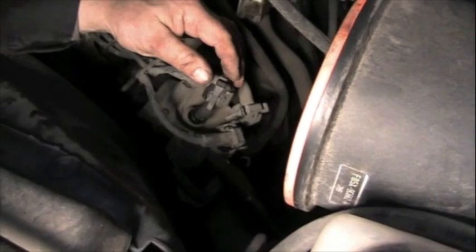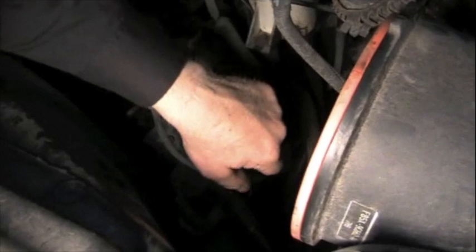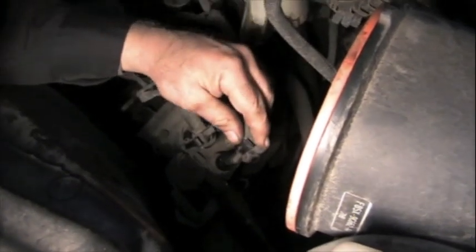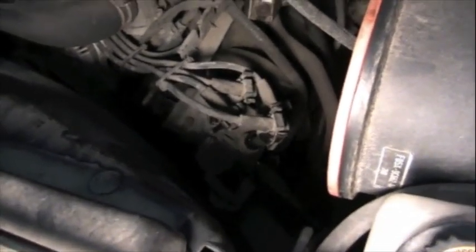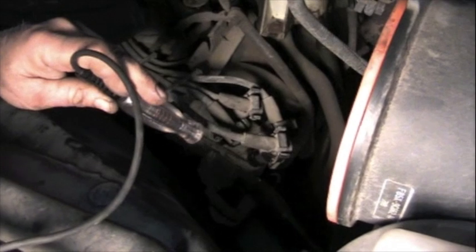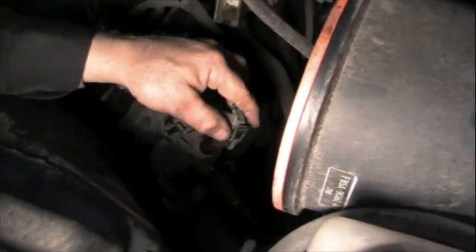Now, was that good or was that bad? There's a good way to test that. We'll take this off of here and put number four back in, then go to another one — we'll put the vacuum hose on number eight and stick that down there. Now we'll start this one. Take the same test light arrangement. As you can see, there's quite a bit of difference there.